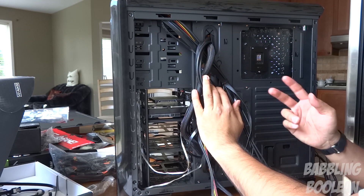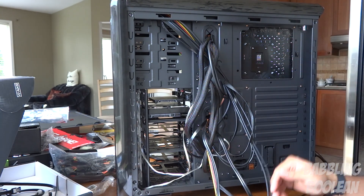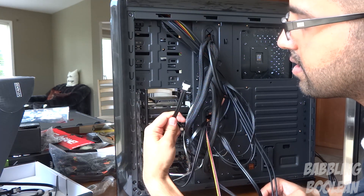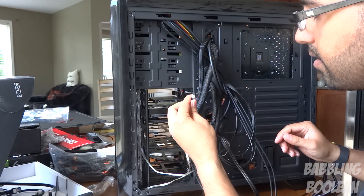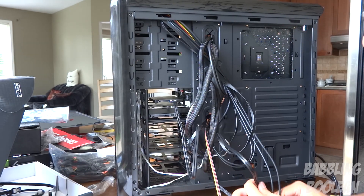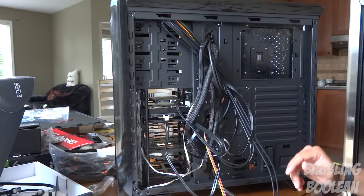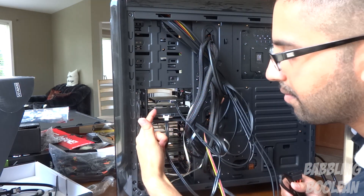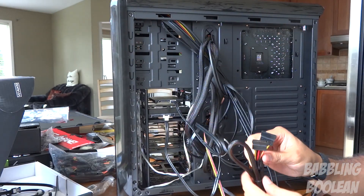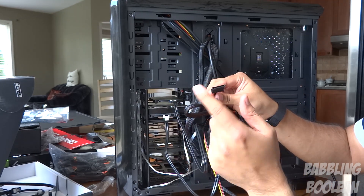This zip tie here was already placed and unclipped from the manufacturer, which didn't really affect me, but you might have to unclip it yourself depending on your case design. I'm going to put the SATA cable here for connectivity. I'll get power up and running in just a moment. That clips in just like that, but right now my two drives have no power. This is actually a similar setup to optical drives — the connections look the same L-shape as SATA, just longer.